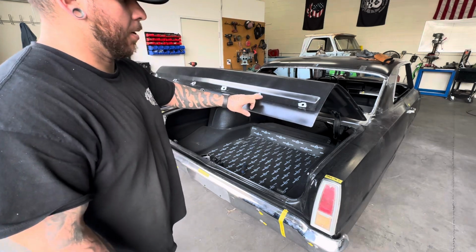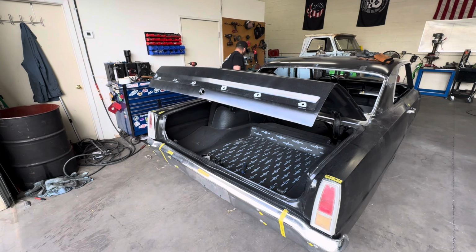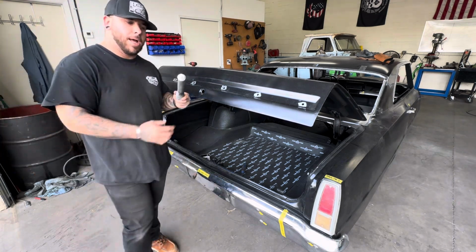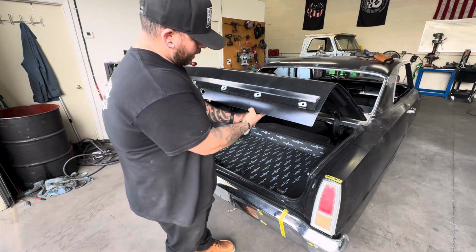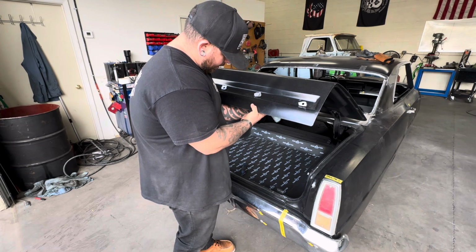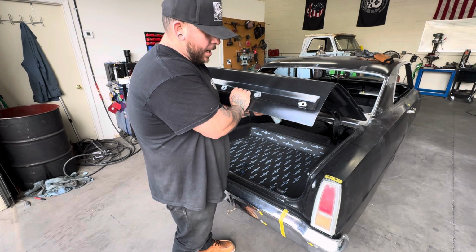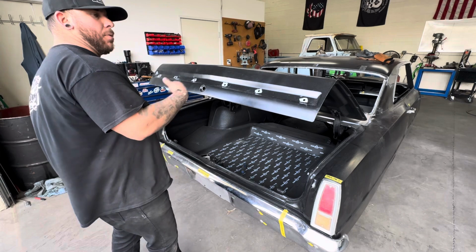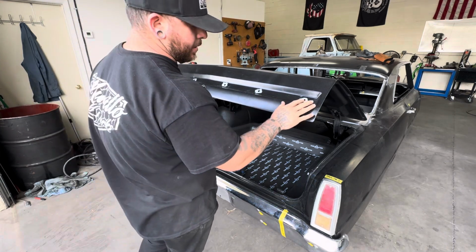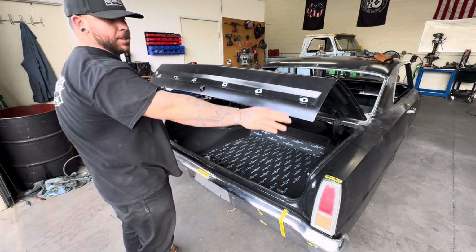So I prepped the area around because it's got EDP coating. And what I'll do is I'll basically just use this aluminum block that I have here. I use it as like a beading stick pretty much. And I'll just stick it in through here and then flush it up, and I'll just make these holes right up. And then that'll give it a flat surface on the back, so you won't see that, as well as fill the holes from the outside. And then I'll go ahead and blend them out from this front side.